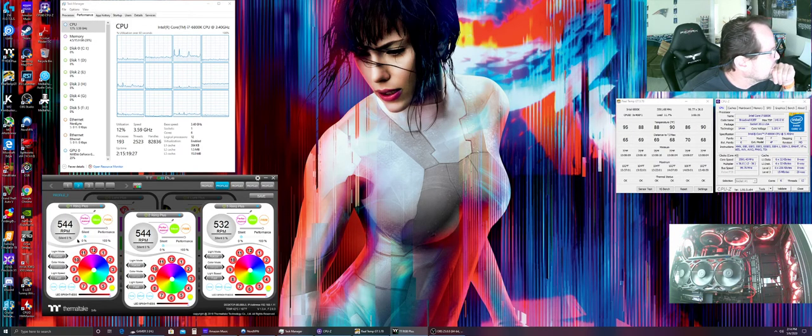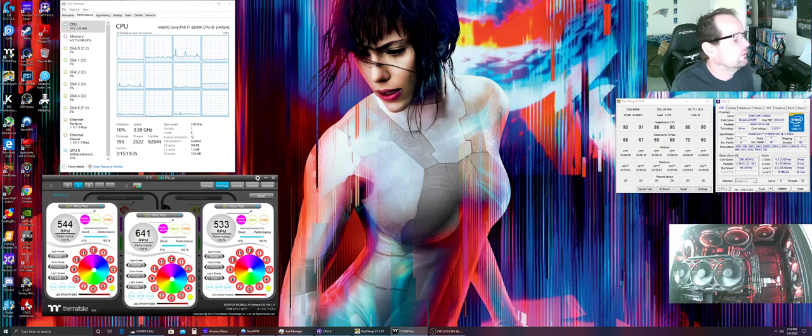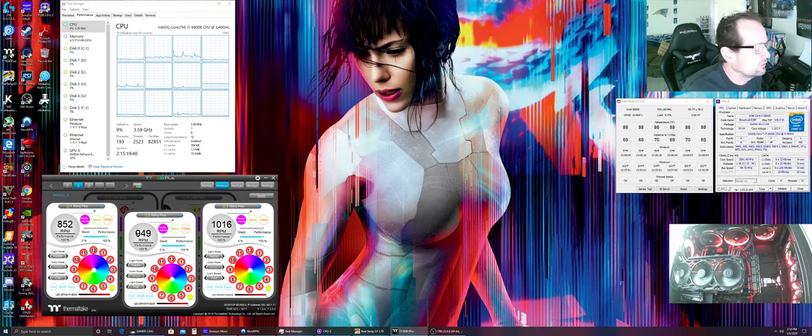And then this one right here, these are the fans, 1, 2, 3 fans that are in the front of my case. So let's power them up here. Let's see if you can hear it. You might be able to pick it up off the mic, because on this computer I don't have an RTX video card, like I have RTX Voice on the other computer. Maybe you can hear them rev up, but you see they went from 500 or 600 RPMs to 1600. That's as high as they go.